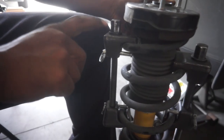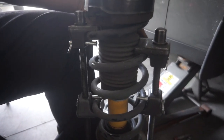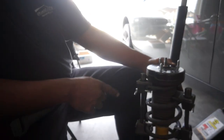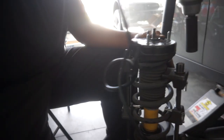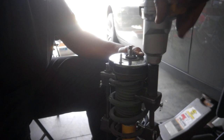You need to go rent spring clamps from your local AutoZone, Home Depot, or any hardware store. You need that to get the springs off — if you don't have it, you basically can't do this mod. Once you get the spring clamps aligned, get them in place, lock them in properly, make sure they're secured, and just tighten them down to take some of that tension off — one at a time, slowly but surely.